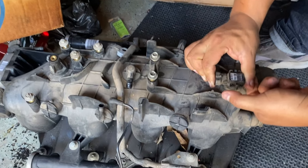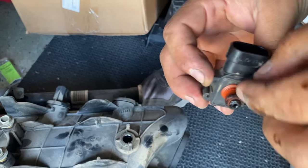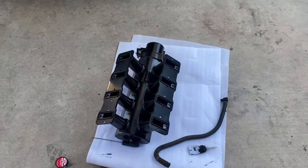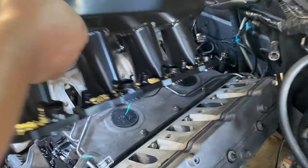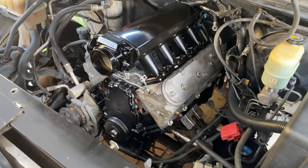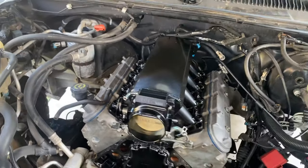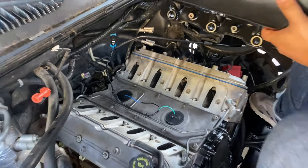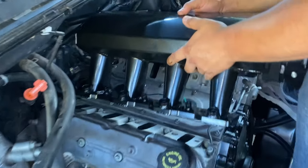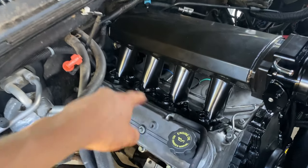For any remaining sensors you're going to need, you'll have to take them off your old manifold. This one right here - that one's for the MAP sensor. Just gonna figure out how to put that onto the new manifold. Just set that up, try to get it fitted good. After slightly bending this line it should sit flush now - yeah, that definitely helped out. Now we'll go ahead and bolt it down and keep the process going.